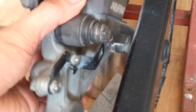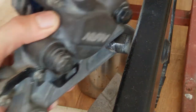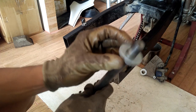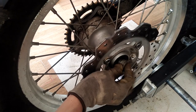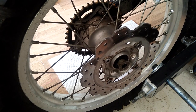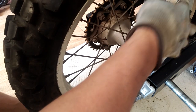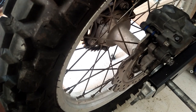With the tab sorted out, we then proceed to attaching the wheel. I am using washers bought from the hardware store as spacers — these washers are originally intended for bolts on wooden posts and they fit perfectly with the wheel axle. I can stack them together to get the right width so that we can be really close to the offset value we wanted. Otherwise, it is also very possible to have custom-built collars or wheel spacers made by a machinist to the dimensions you specify.